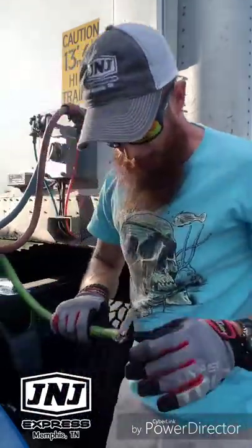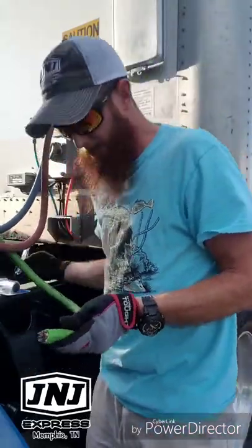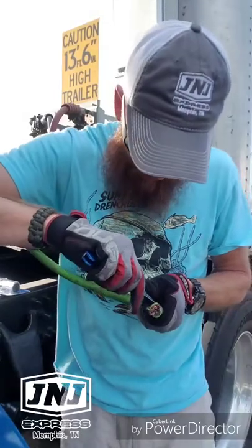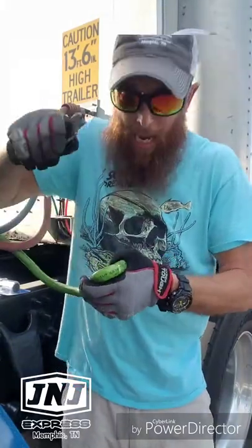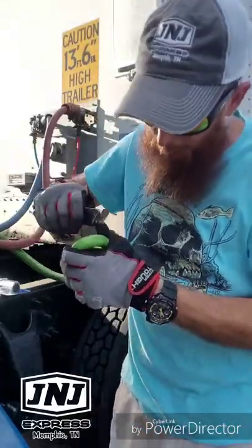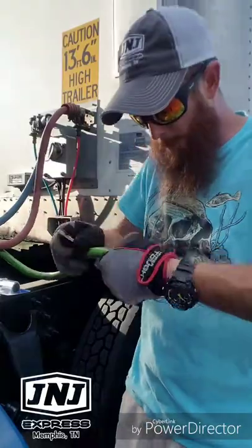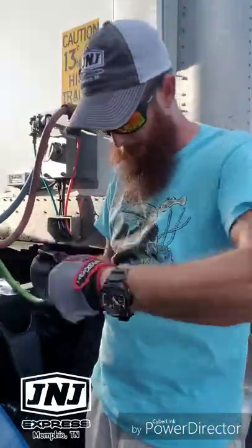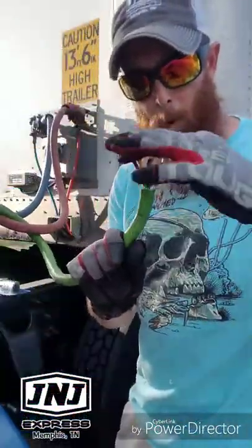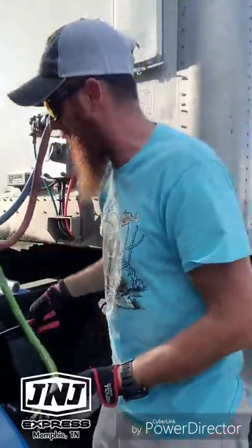Alright. Now, what I'm going to do, cut this back to expose my wires. Always cut away from yourself. I like to push the knife, bend the rubber, keep from getting into your power line, to your cords themselves. You don't want to nick them. Alright, so as you can see, I have exposed all my wires. I got my red, yellow, blue, green, brown, white, and black. Pretty much all your standard wires on any trailer. Go ahead and strip them down.